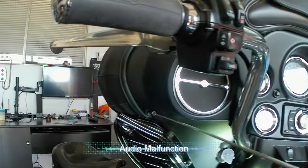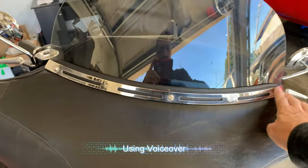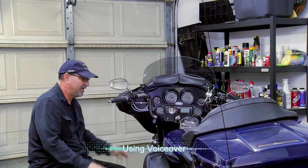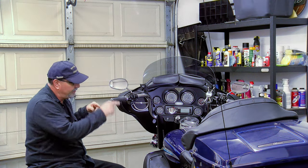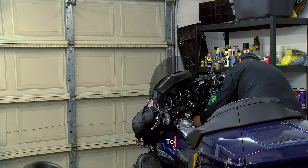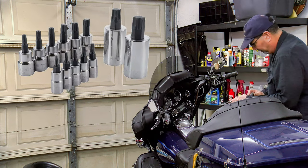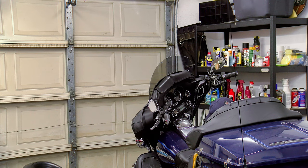You have a bolt here, a bolt inside the fairing, two bolts on the other side, and three bolts on top of the fairing — for a total of seven bolts. That's one of the things I like about Harley-Davidsons: they don't use a lot of bolts to fasten things down. Tools I like to use: a quarter-inch ratchet, a quarter-inch six-inch extension for the two bottom bolts inside the forks, and a Torx bit socket set — Torx head bolts are used to fasten the fairing down.